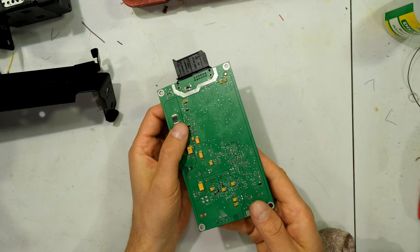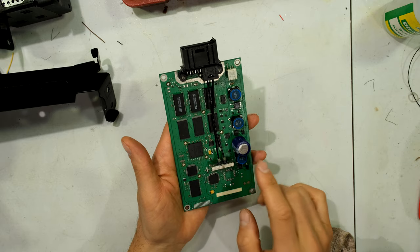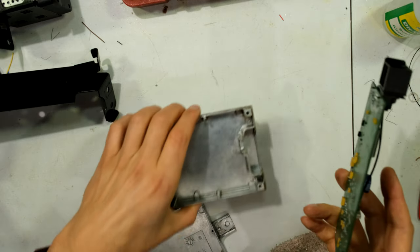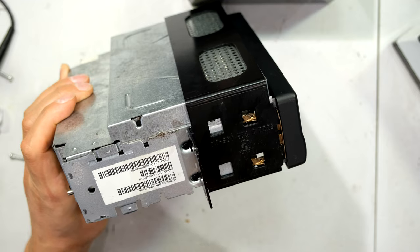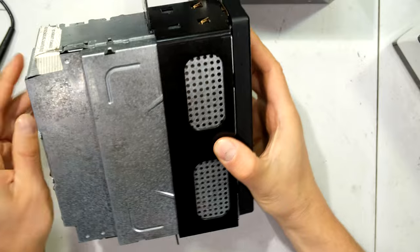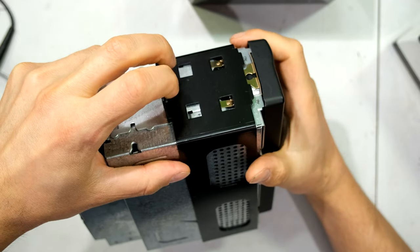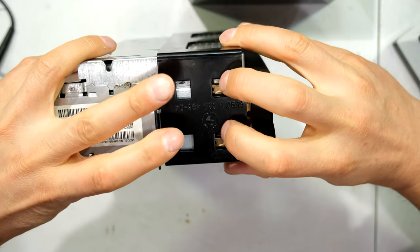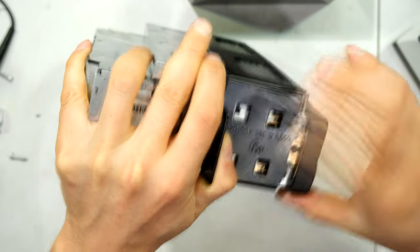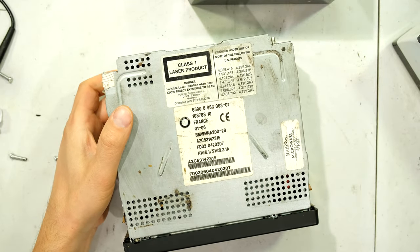I want it to be completely dry, so I'll leave it in the sun for a few hours and then reinstall. I've cleaned as much oil off as possible and left it in the sun for one and a half hours. I don't want to leave it too long because there is an electrolytic capacitor and I don't want it to dry out. I'll now return it into the casing. To open up the navigation I need to depress two spring clips on one side and two more on the other side — I do one side, pull back, then the other side, pull back, and slide the cover out.